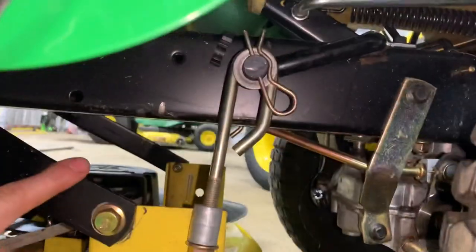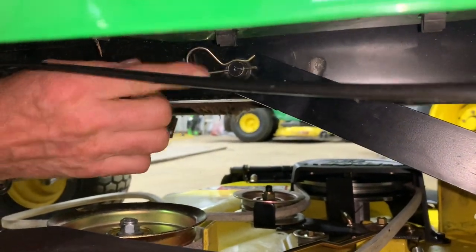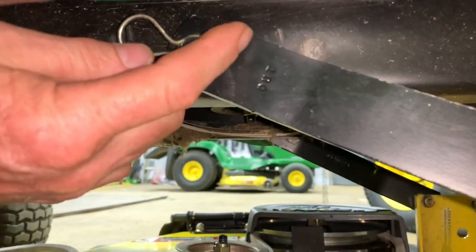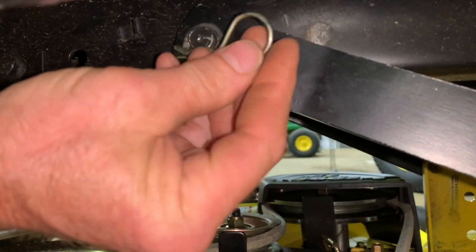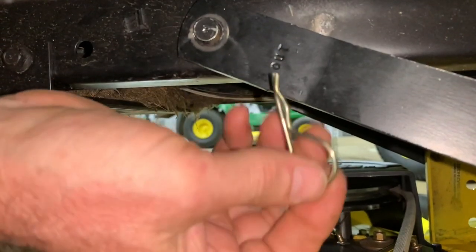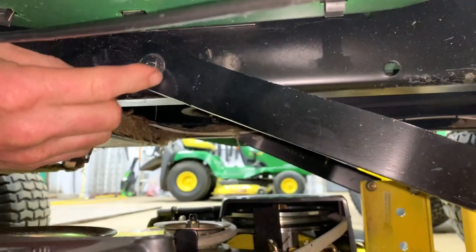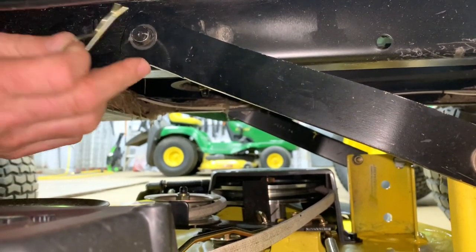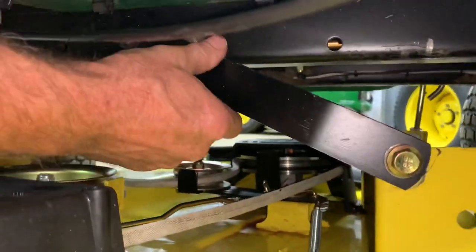We have two guys here we have to take off. This is the one arm that holds the mower deck up. Just pull this pin forward. Make sure these pins go back in this way, because if you're driving forward they're usually not going to pop out that way. If you have them the other way and you're driving forward, it can actually pop out if you hit something — then you'll lose them and your deck will fall down and you'll have bad cutting. So just make sure you put them back in that way. As you can see, this looked like it had a washer at one point and this one has lost all his washers. I put them back without the washer, but technically there should be a washer here. You're just going to hold up the mower deck a little bit and then take this off. Don't lose your clip.